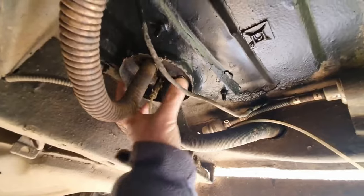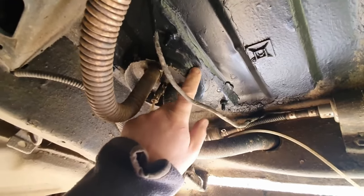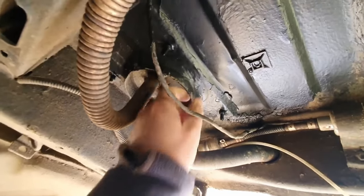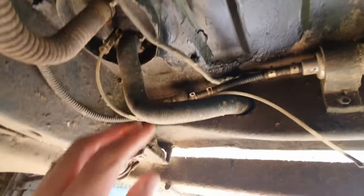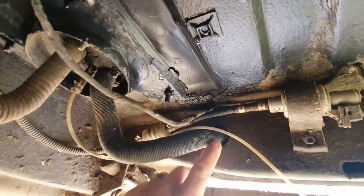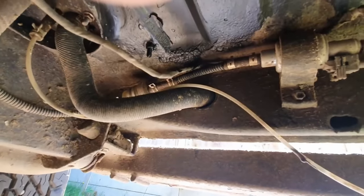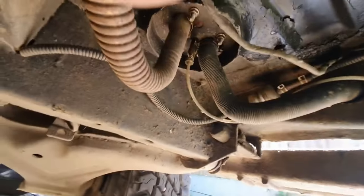There's a turret mount where it comes from underneath the back seat — excellent bit of kit. I drilled the hole for it with a hole cutter and used mastic around it — Dogs Bollocks, that's what it's called — and it dried lovely, nice and sealed. The inlet for the combustion chamber draws clean air from the inner side of the sill — it works fine, no problems so far. In terms of pipe work, the inlet I did exactly the same as Keith did.